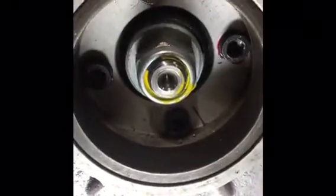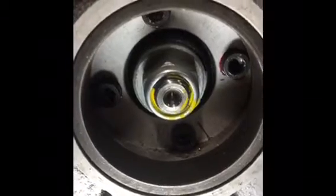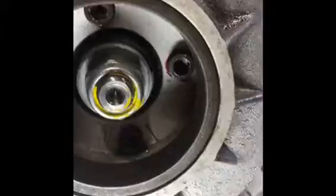Put it back together — the flywheel is reinstalled. The big nut was torqued at 37, that's what the man at Recreational Power said to torque that one at. Also torqued the four Allen screws that hold this piece in — it's sort of pressed into this flywheel.